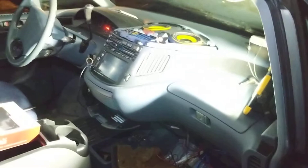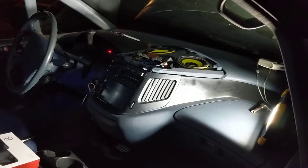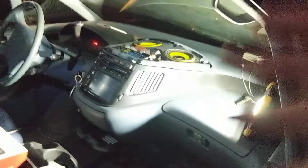So yeah, this was actually a pain. The stereo install — the amplifier and wiring — was traditional and actually probably easier than some other cars I've done. The biggest pain was fitting those five-inch woofers. I couldn't find a four-inch base driver — the five-inch was the best I could find. If you want some high-quality four-inch speakers, especially a two-way with some amplifier power, you might still be happy with the sound. But I wanted no tweeters in the dash since I already had so much coming out of the doors.